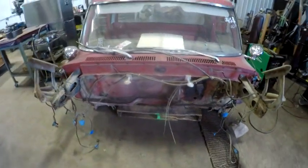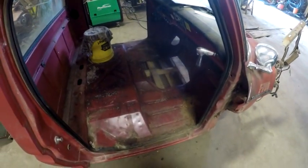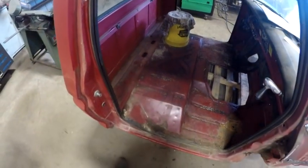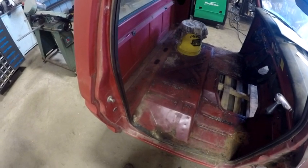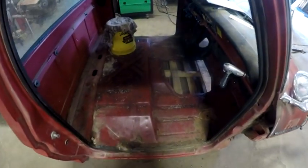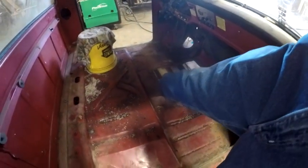I probably should note one of the things that I did. I took some rough measurements from those two slots, which are where the rear cab mounting bolt holes go. I took a rough measurement from the frame, where those bolts go down through the frame cross member, up to where the shifter is. And the shifter is fairly far back. It's actually out of that cover plate provided for the old transmission, and actually ends up back in here.